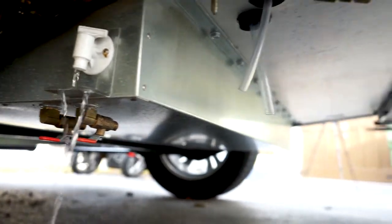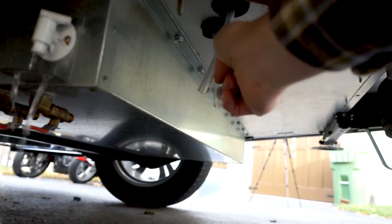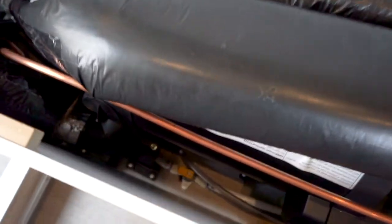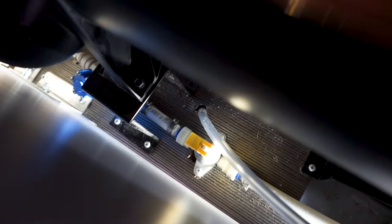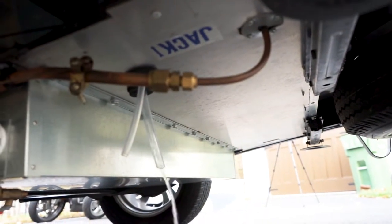As those are draining, we're going to open up the valve for the hot water tank release. That's going to come out this pipe here, but I'll show you where the release valve is inside. Inside the Base Camp, open up the cover to your mechanicals area. Down next to the Truma system, you'll see a valve — if you lift this valve and point it straight up in the air, it will open the valve to empty out your hot water tank. Just lift straight up. Now you can hear all the water draining out. Coming around outside, you can see all the water from the hot water tank draining out of the system.